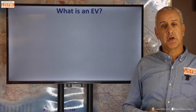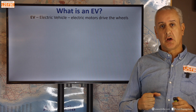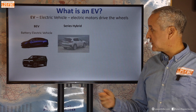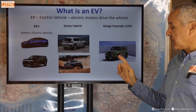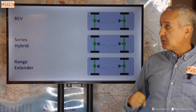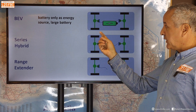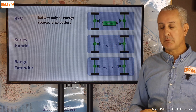What is an EV? That's actually an interesting question in the context of the Fusilier. The definition is: an electric vehicle is a vehicle which uses electric motors to drive its wheels — which is not the same as a BEV, a battery electric vehicle, like a Tesla Model Y. We've also got series hybrid vehicles like Nissan's X-Trail e-Power and the Dakar-winning Audi, as well as the range extender, which is one of the options for the Fusilier. So the BEV has the battery as its sole energy source, with a large battery powering the front and rear motors via a software differential lock.